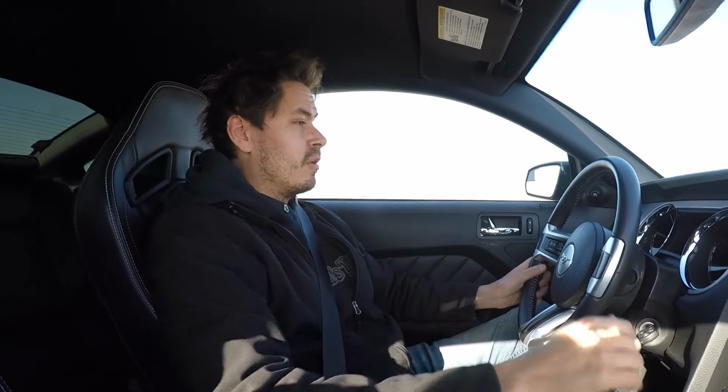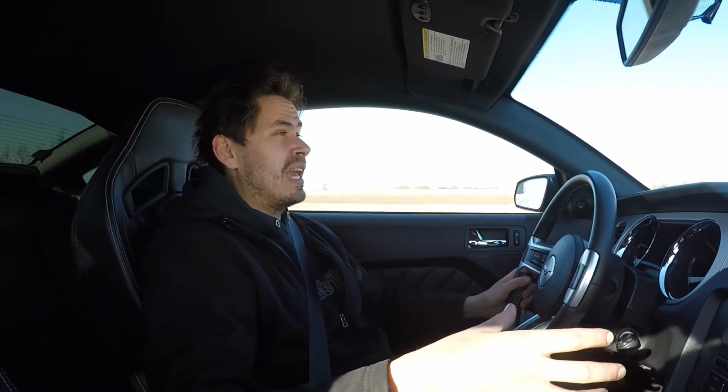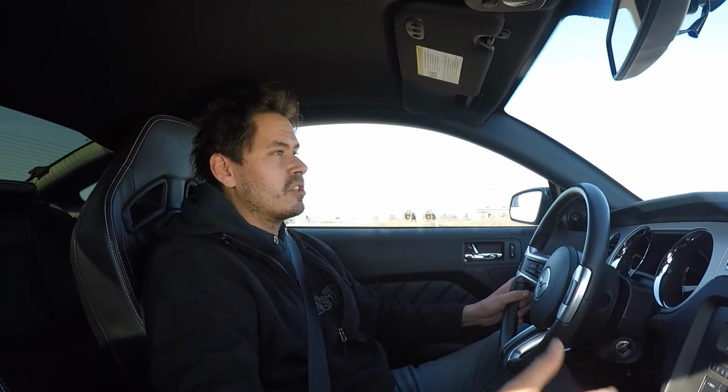Okay, so the brakes are probably worth the money. We dropped about a half a second and 10 feet in our stopping distance and time to stop. But now we're to the point where we are over braking the tire. The ABS is starting to be invasive. There's not enough traction there to actually slow the vehicle down. So I think there probably is a lot more brake to be had with better tires on the car. It's actually warmer today than it was the last test, and the ABS didn't come in that hard with the cold tires and cold pavement. So there's a lot of brake there for the money. I think this brake upgrade is probably worth it for anybody that's going to track or autocross their car, or maybe just wants it to even look a little bit better.